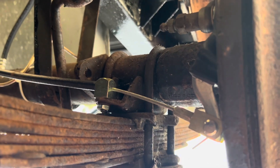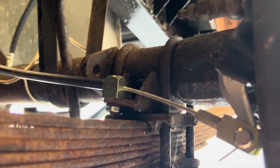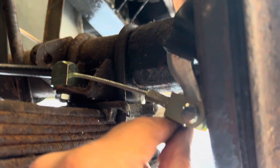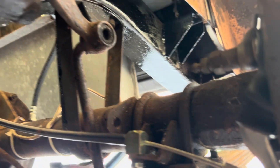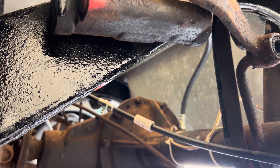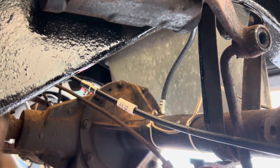It's Hammer and Hatchet Engineering and I got the second brake cable in. I had it on slow mode — I was trying to do time lapse. Anyway, I got this part in and then I put the new cable attached to the emergency brake part, new cotter pin, and now I'm going to stick it into the car and hook it up to the emergency brake. I'll put this one on time lapse.